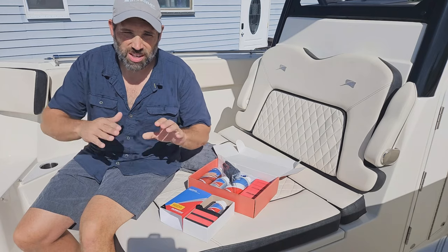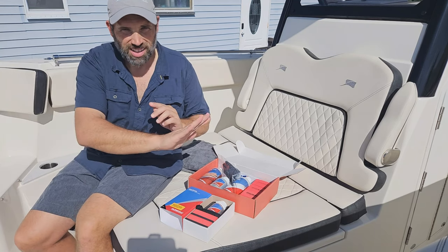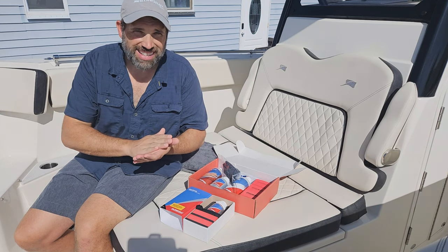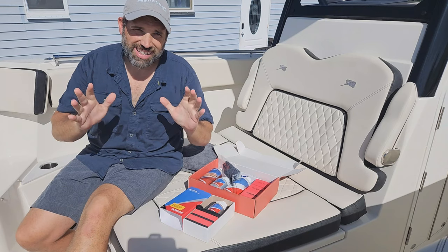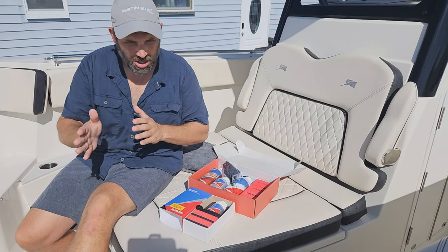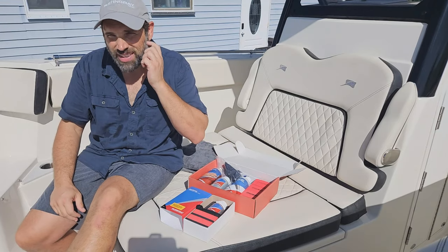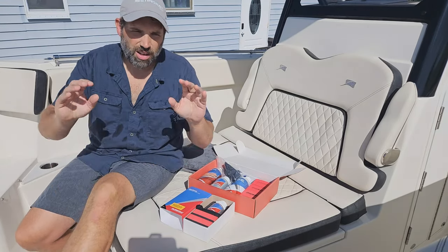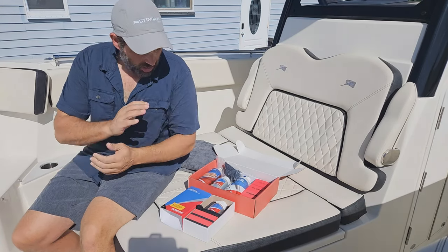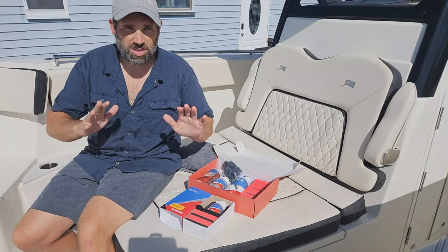You wipe down and wipe all the wax off. If you didn't use enough alcohol you'll see some streaks of alcohol-thinned wax — you've got to get it shined up. I do have the 3M medium cut compound — I have light, medium, and heavy. There were a few spots where the nano polish wouldn't take off a mark, so I brought in the medium compound. The nano polish is really light — doesn't have much grit. Then you strip all the wax, get down to the bare gel coat, and apply the ceramic.